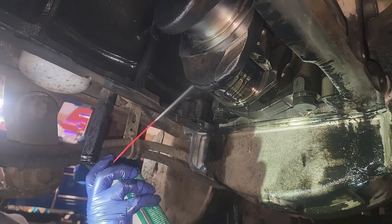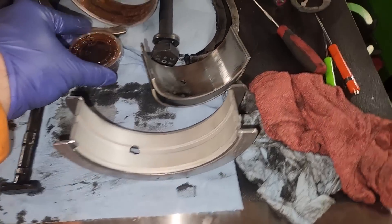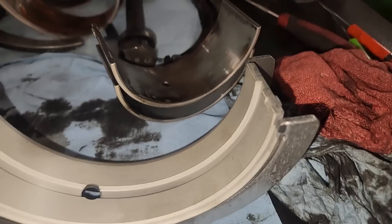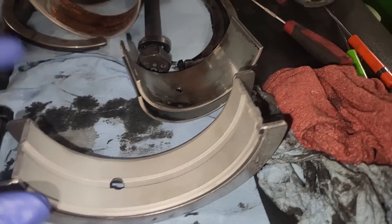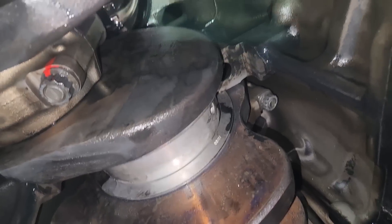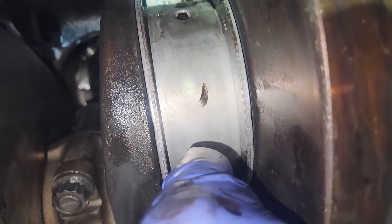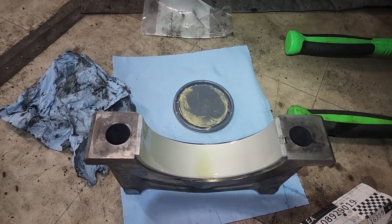Just giving a little brake-clean bath to get all the old nasty oil out of there, then putting in the new rod bearings. This is the upper main bearing on number six — it's three-piece, as you can see. The main itself is one piece, but it's a special bearing with grooves cut into it so the thrust bearings can be installed by rolling them in. This was not easy — I thought they would actually fall out while trying to install them. The hardest part was the very little gap to push these bearings and roll the upper in at the same time.